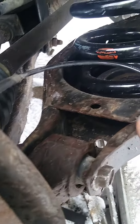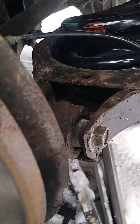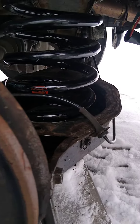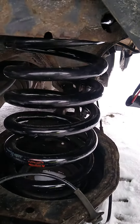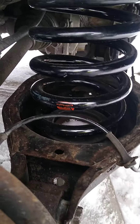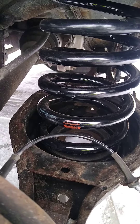Take this bolt out where the spring seats. I had a jack stand underneath the control arm, then took that out and lowered the truck by the jack at the center of the frame. Then I slowly lowered down the spring holder using the floor jack and the old spring pulled right out.